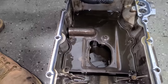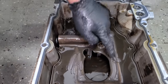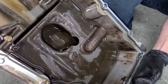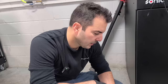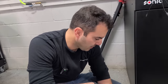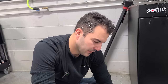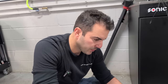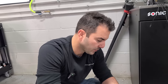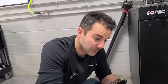This isn't looking very promising. The bearings are definitely going to be in bad condition. We have bearing chunks in here — look at that. This is not good. I got so lucky with the overheating issue; this thing had a bad motor from the get-go, it just didn't make any noise at all. Now, it doesn't necessarily mean it's a totally bad motor — I have replaced many bearings on cars without even taking the engine out. The Grand National is like that and I put about 3,000 miles on it after doing the bearings and it's perfect. Let's just hope the crank isn't messed up.